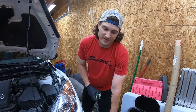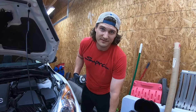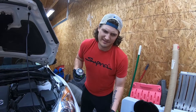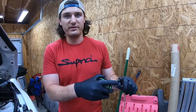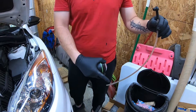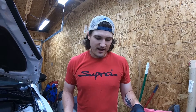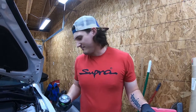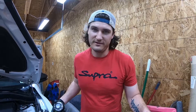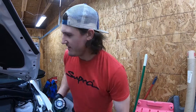You can find things like this at Harbor Freight for a pretty good price. If you don't want to spend as much money you can also just use a turkey baster — they even have things similar to that at Harbor Freight. As far as bleeding from the calipers, I have this tool where once I take that rubber grommet off, I stick this over the bleeder screw before I break it loose. You can see the fluid coming out through here, and you can tell it's dirty, then just keep pumping the pedal until you see it come through clean. You can just break the bleeder screw loose and start pumping the brakes, but you might get brake fluid over all your stuff, so this keeps everything clean.